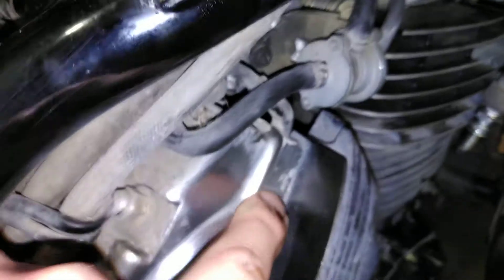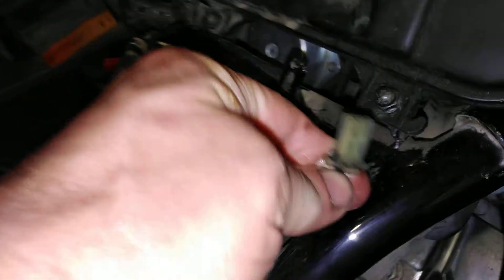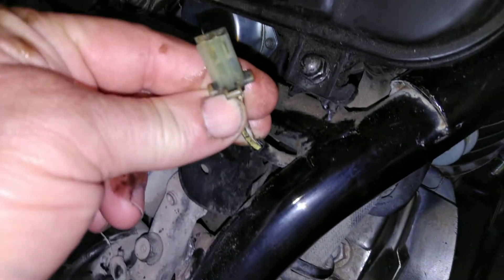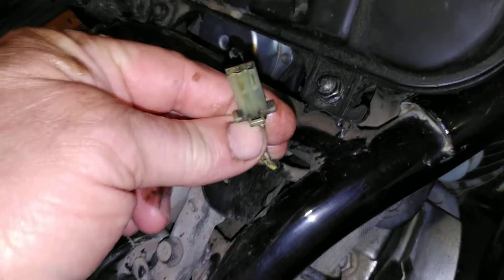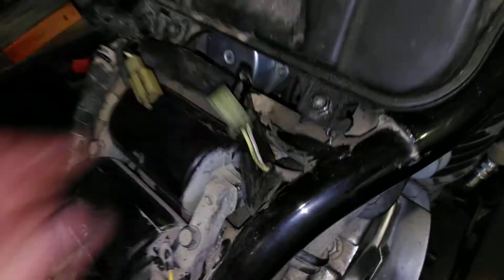This is an '85 — the '85 and '86 models have a wire that goes into the head right there; that is the cam position pulsar. This one tests out at 1.045 megaohms, which is way out of limits, so this motorcycle had no spark.